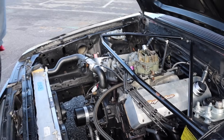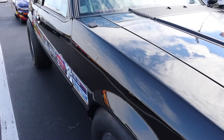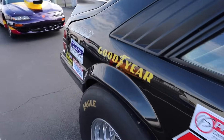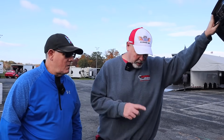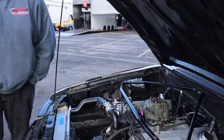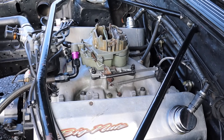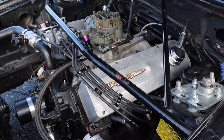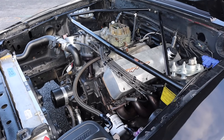At the time, Billy sold the 71 car so he had a bunch of leftover pieces. I ended up getting those from him because I blew my Windsor up bracket racing. And then Dad, when he worked for IHRA, said, 'Why don't we do this?' That's where it all started. They had so much stuff over the years I just kept using it all, then had to start buying my own when I finally destroyed theirs. The only difference from this and the 73 stocker motor now is the manifold — I put the aluminum 71 manifold on it just to get weight off the nose when I went to the Superstock stuff. It's a 73 — dish piston, small valve, four barrel motor — but it all works out close to the same compression ratio as a 71 or 72, and same camshaft, so it was easy to switch over.